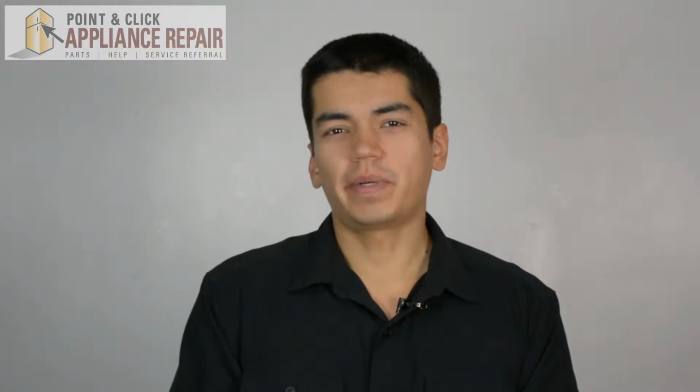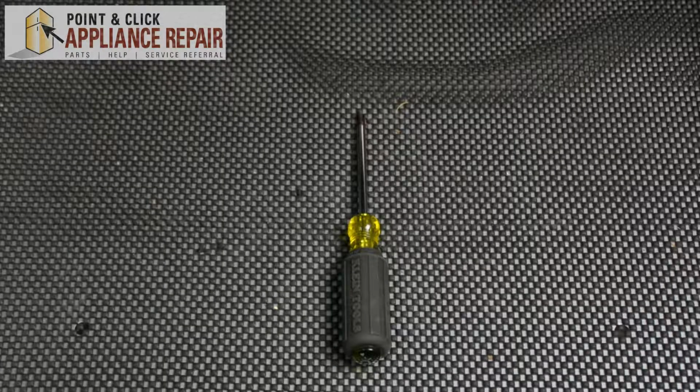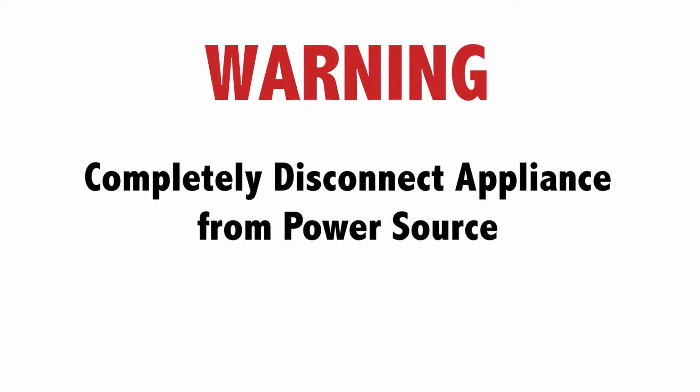The reason why you might have to replace the strike in your dryer is because it's damaged or it fell out, or because the door won't stay closed. For this repair, all you'll need is a Phillips head screwdriver. Warning: before doing any repairs, please disconnect your power source.